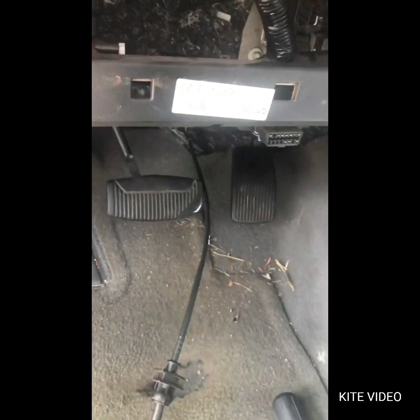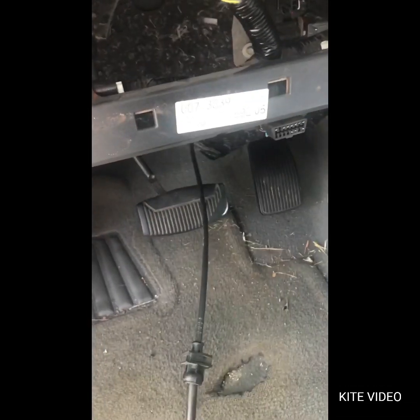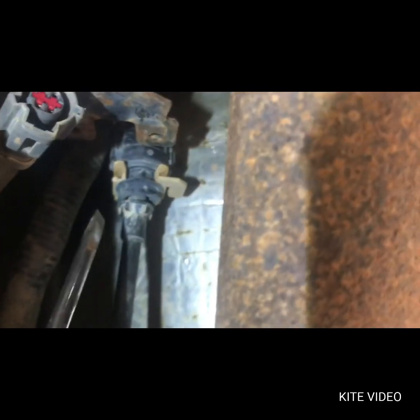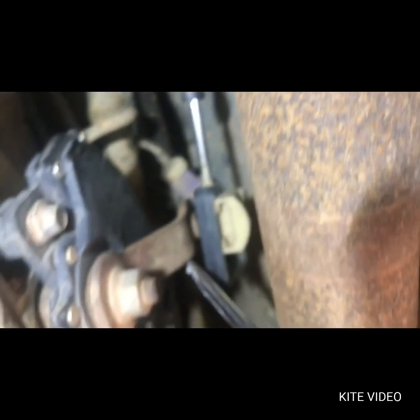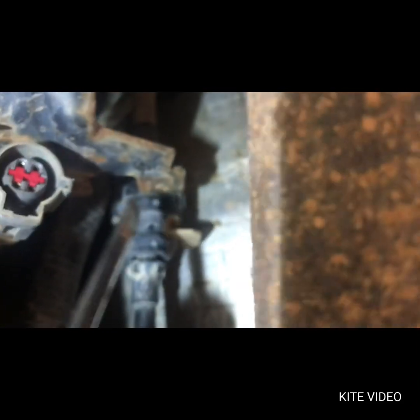Okay, now that the top of the steering column cable is off, the shifter cable, we've got it disconnected. We're going to crawl through and pull this through that hole out the bottom. Alright, next step. This is the bottom end right here. It comes down and connects to your gear shift pin on your transmission. That's your shifter. So it connects here and it connects here.